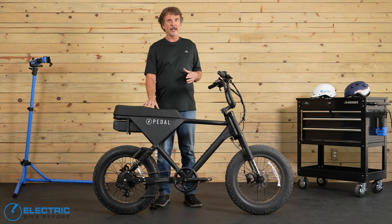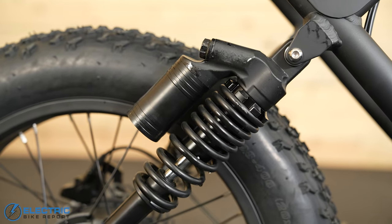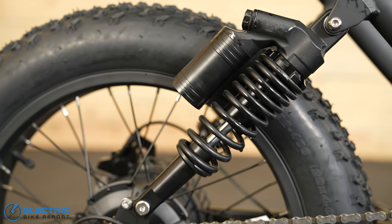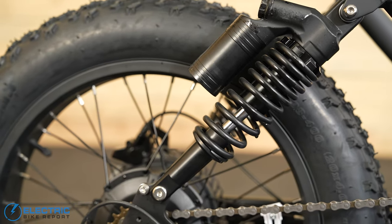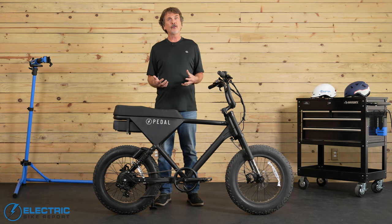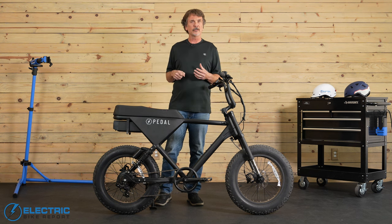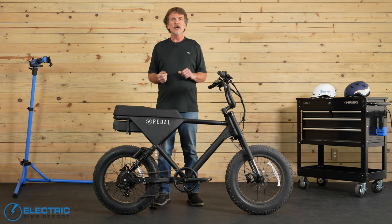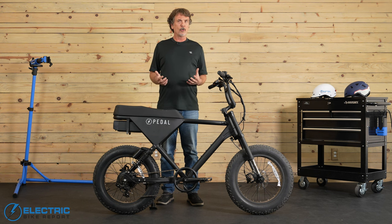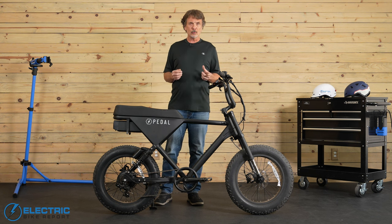And if you like riding with a passenger on the back seat, this helps explain why Pedal chose this dual rear shock design. The coil spring is more durable and can handle more weight than air shocks you normally see on fancy e-mountain bikes. They also require less maintenance than air shocks and are easier to adjust the preload — all you need is a simple $10 spanner wrench. You don't see these shocks on e-mountain bikes because they weigh a little more and are a little more rigid than what e-mountain bike riders want.